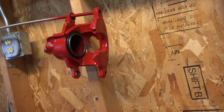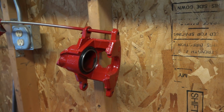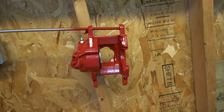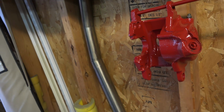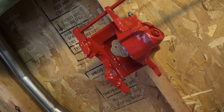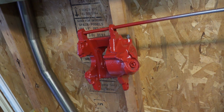Now the nice part about that is, to do a rear disc brake swap onto this, thanks to CaptainFab who makes the brackets, it uses the D52 style caliper, and since I had an extra pair of them sitting on my shelf, I was already a good portion into the investment needed to do this swap. It took a few minutes to make sure these were in good mechanical order, get them all cleaned up, taken apart, and painted with a matching red caliper paint. I'm not trying to imitate the Wilwood style, but having red front calipers and just a plain metal rear caliper didn't make sense to me since you're going to see them, so taking a few minutes to get them reconditioned seemed like a worthwhile investment of time.